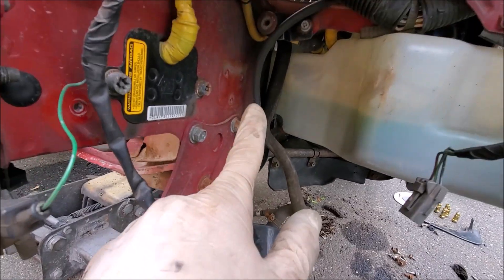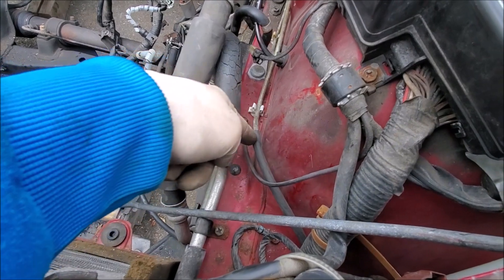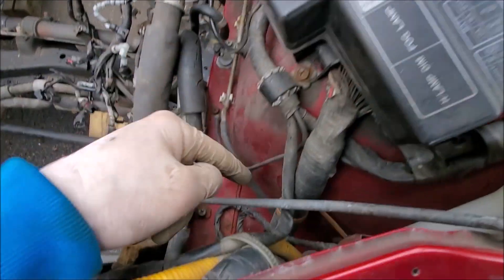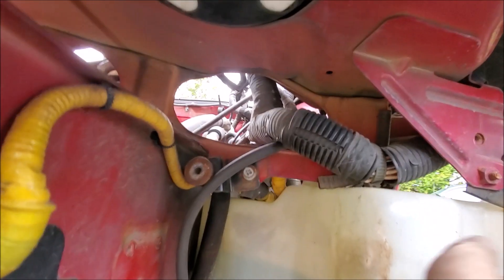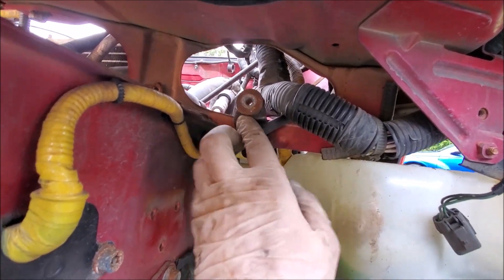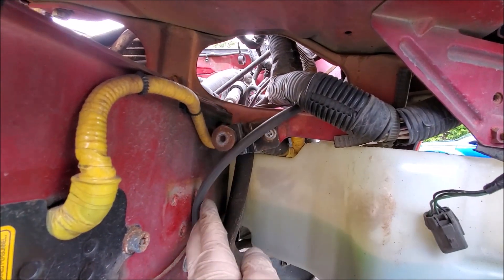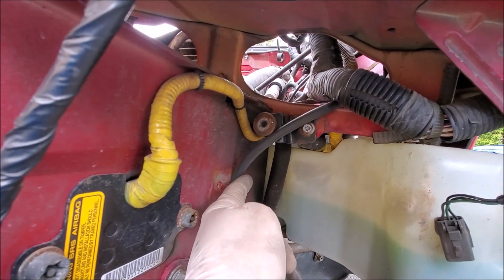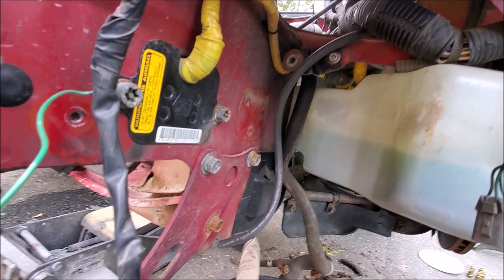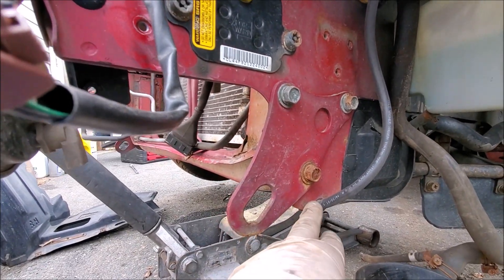I have my line run and that's it — it's literally that simple. The line goes down through here; I tucked it under the wiring harness to the fuse box, tucked it under, and it comes right through there. This bracket holds the cold air intake piping, so that's how it's bolted up. I ran it through there and I'm gonna use a self-tapper clip just so this stays out of the way. It goes right down to that line there.